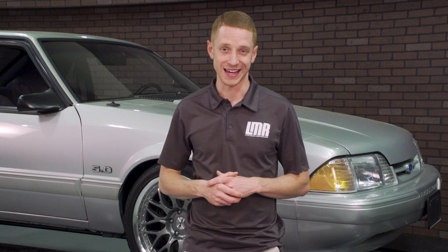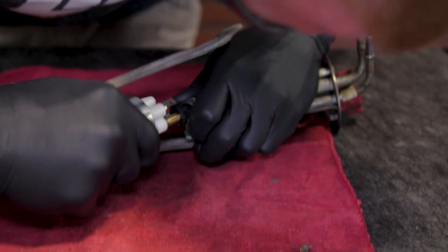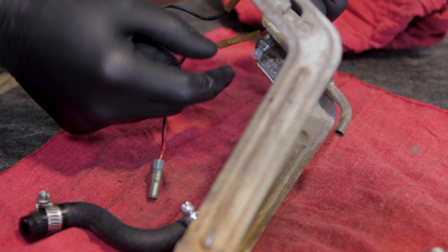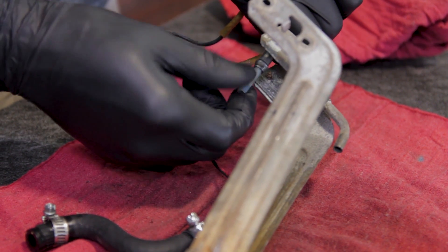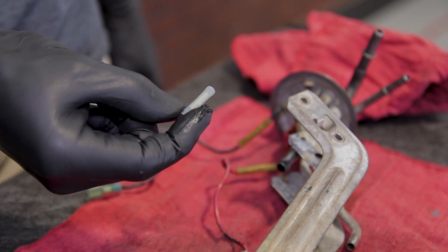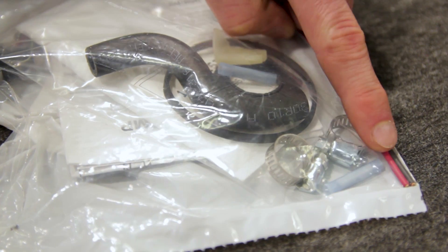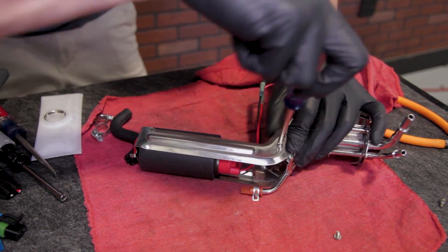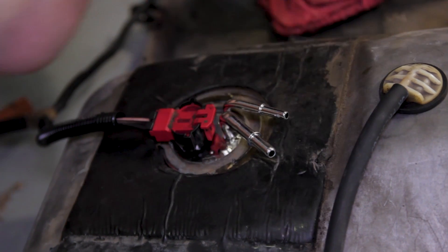Here's when it gets pretty crazy. Upon removal of the fuel pump bracket and S-hose, a small glimmer of blue exposed itself from the supply line. After all of this back-and-forth nonsense, there ended up being a damn butt connector in the supply line of the fuel pump bracket. More than likely it got there from the previous owner — the S-hose they put on probably had a butt connector work its way in, since those components come in an installation kit inside a little baggie. Guys, I can't make this up — that butt connector in the fuel pump bracket supply line is real freaking life.